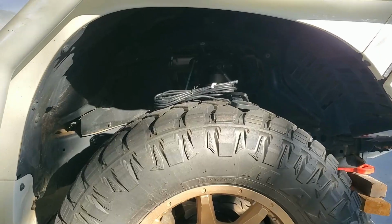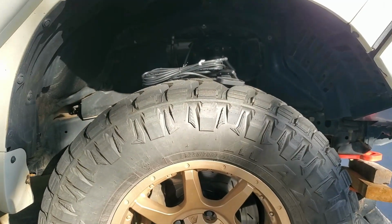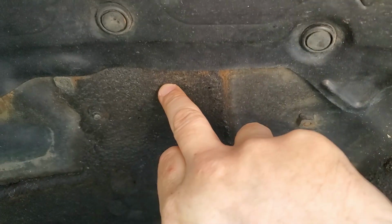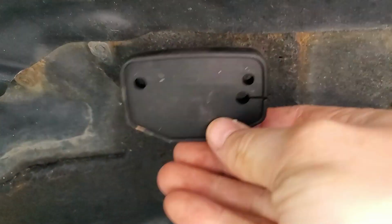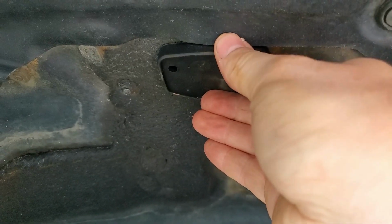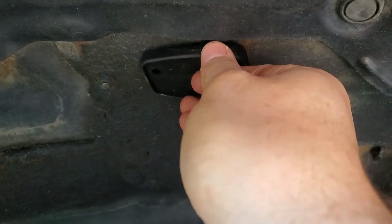the car. So starting with the front wheel arch, ideally you want it to be central to the wheel, so directly above it. And basically you can see here's a plastic guard, and we want it to go into metal, because if you ever need to remove this plastic guard, I don't want to have to take the light out, so we're going to put it in the metal here. So using the actual rubber template, we can sort of find a home for that, which I reckon will probably go about there. Again, the actual wheel arch is not a completely flat surface. That's what the rubber gasket is for.